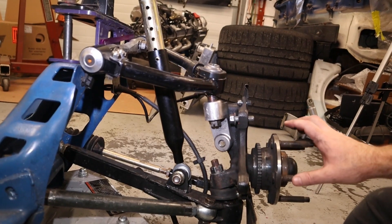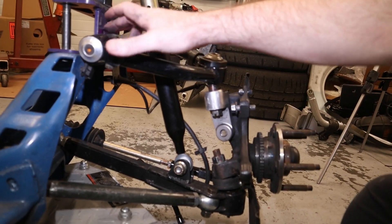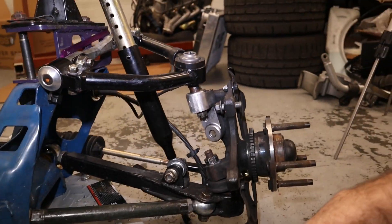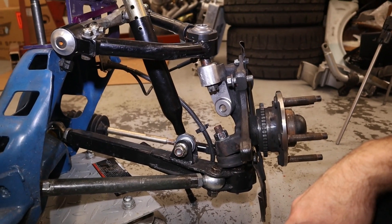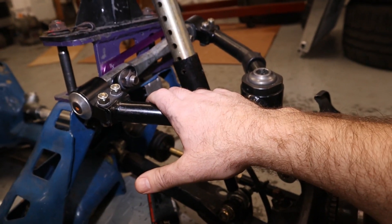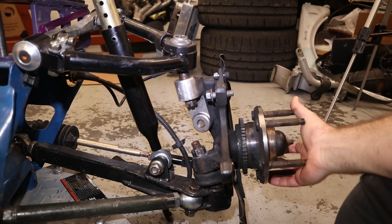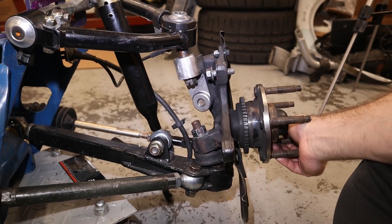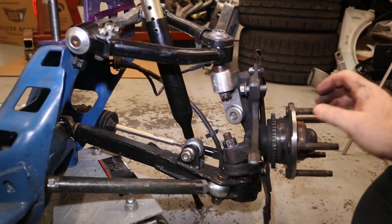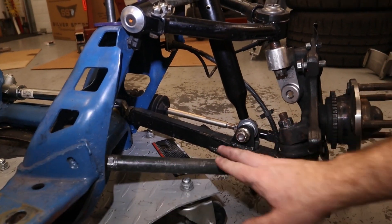Some specs of the suspension: I can get a maximum of around negative four degrees of camber just by removing and pushing in the shim plate, and a whole lot more if we actually adjust the lower control arm. I have tons of caster range any which way — it's currently set up to around five degrees of positive caster. The camber curve is around one degree per inch, maybe a little less. That's all basically limited by where you can position your upper and lower control arms.